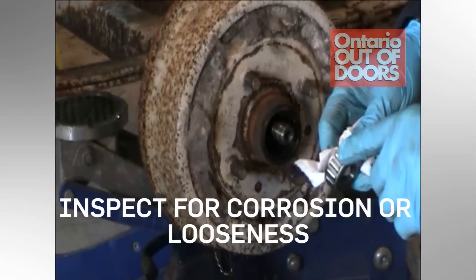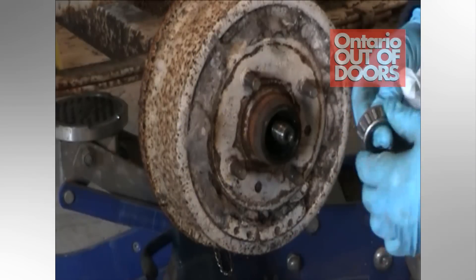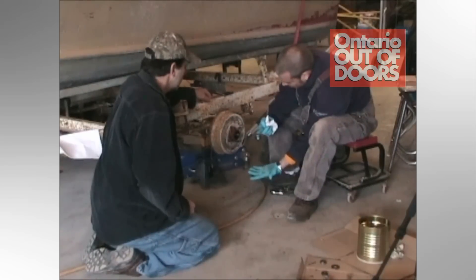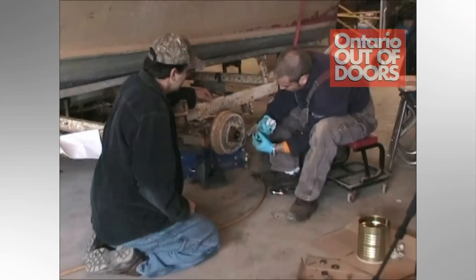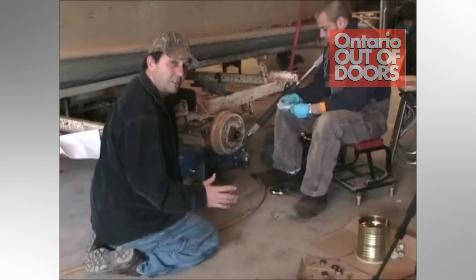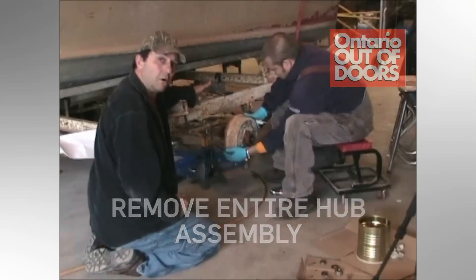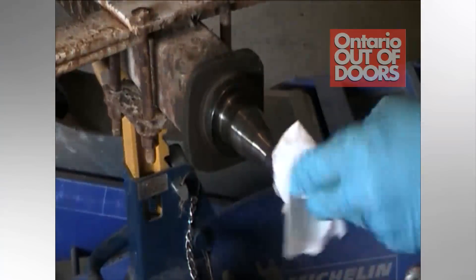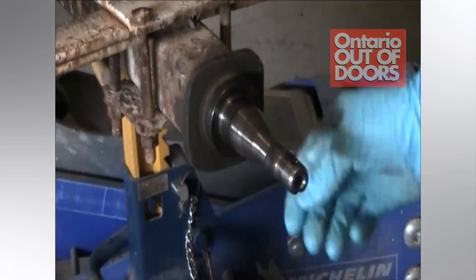You want to look for any corrosion on the rollers and make sure it's nice and tight — not loose or shaking side to side. If you get a really bad one, these rollers will actually pop right out of the cage, and when you pull the hub off you'll have rollers laying on the floor. So make sure there's no indications of heat damage, that the roller cage is intact with the rollers, and that there's not excessive play. Once you have the end of the axle exposed, clean off any grease and grime, inspect it, check the threads, make sure there's no burring and no rust — that one's actually in very good shape.